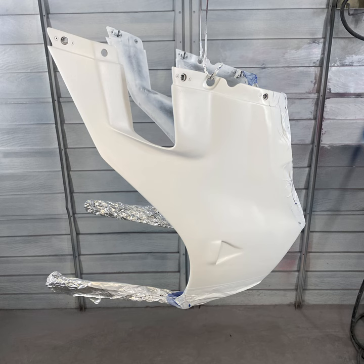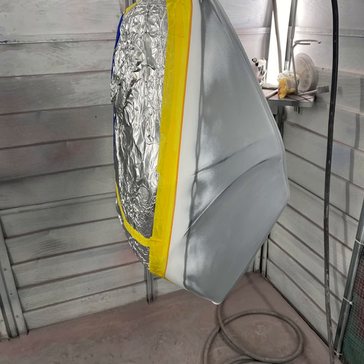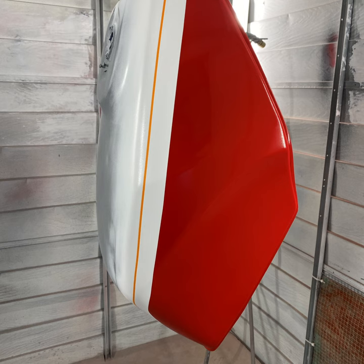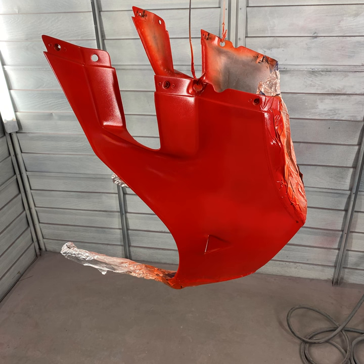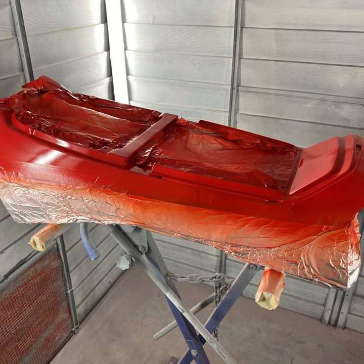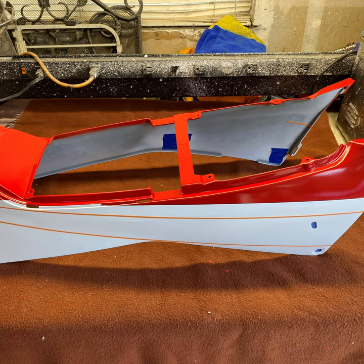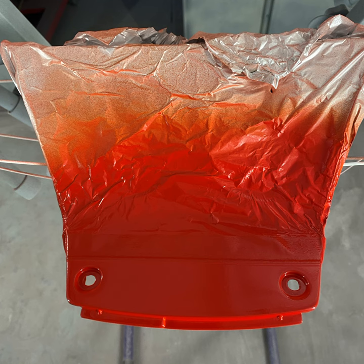Having taped out the white areas, I now mask off everything but the red areas on each body panel and tank. Where the shape is complex and difficult to mask, I use foil wrap. I then apply the 1090 base coat, followed by three coats of fighting red. As the paint starts to tack up, I remove the masking where possible to provide a crisp edge. The harder the paint cures before you do this, the more likely it is you can peel the paint back from the edge, requiring touch-ups further in the process. I repeat this for the tank, upper cowl and tail sections.